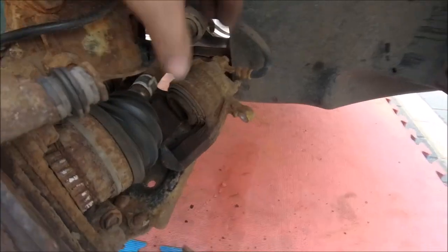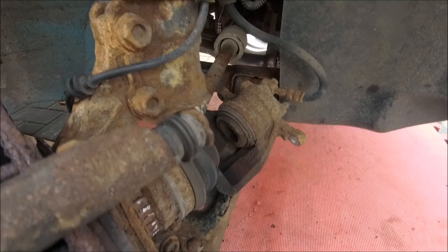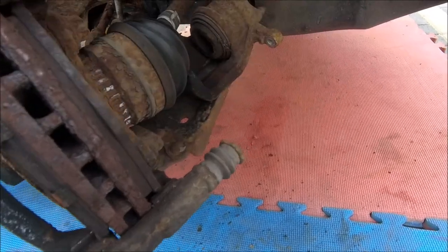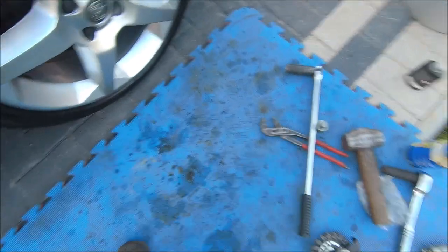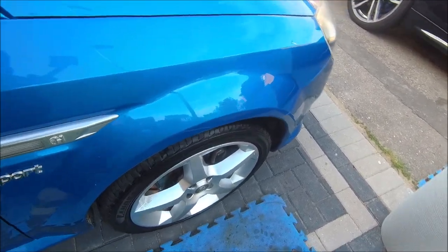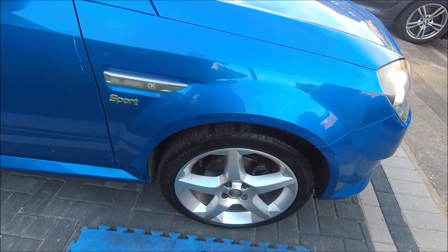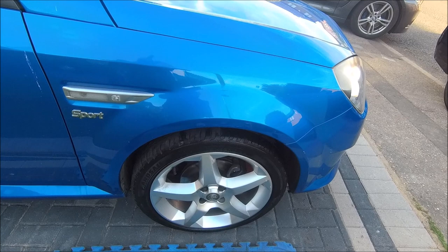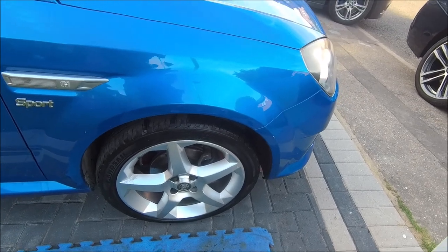No real drama getting those off. Pulled the piston against the brake pads and it went back okay. The pins this time — that one's a little stiff but nowhere near as bad as the other side, so this should be quick and easy. And there you have it, all done. The only thing I've got to do now is a quick tidy up. That cylinder — or that slide over there — was pretty much seized. So that was the problem, that was the imbalance.